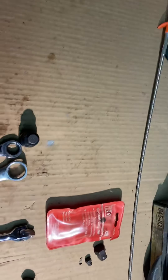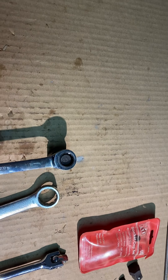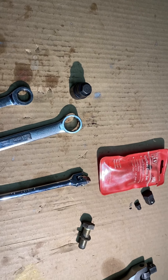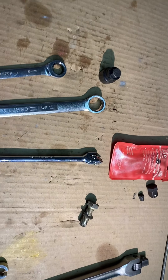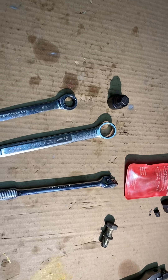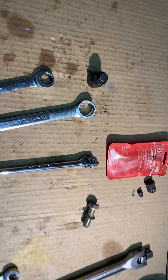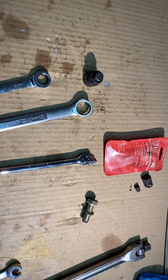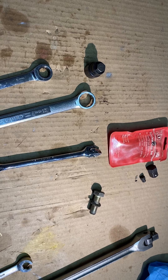To be honest with you, there must be a special tool, something like this with a built-in offset, that you'd use to get in there and do it — because you're not getting even a 3/8-inch drive ratchet in there, no way. And if you did, you'd have to lean on it so hard you'd blow it out, or at least weaken it. But anyway, that's how I did it — I got it loose, and it took me a little bit of time to figure this out, so I figured I'd mention it.